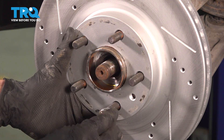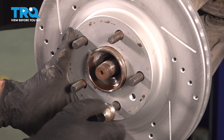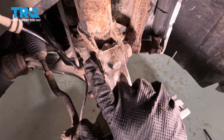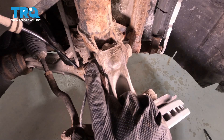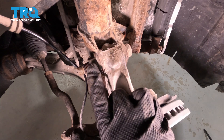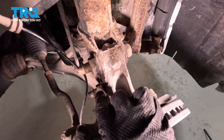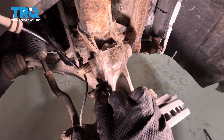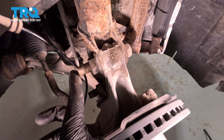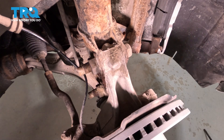Let's install one of our lug nuts here to hold the rotor in place. We need to remove both of our camber bolts that are holding the front steering knuckle to the front strut. For these, you want to go ahead and remove each of the two 24-millimeter mounting nuts. We'll start them each on just a couple threads, and then we'll start tapping on the very tip here, forcing the bolt out towards the front.